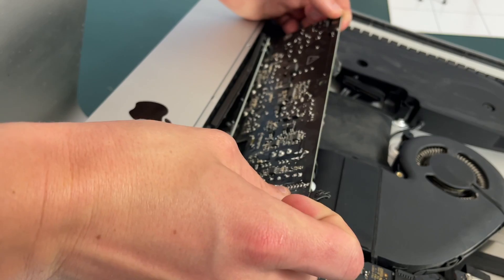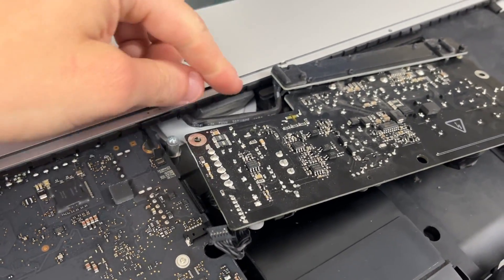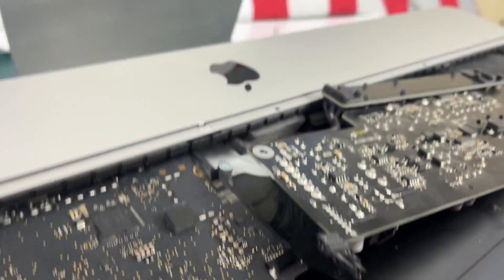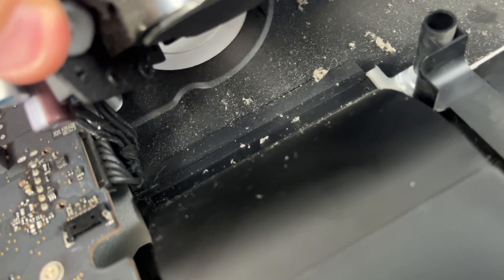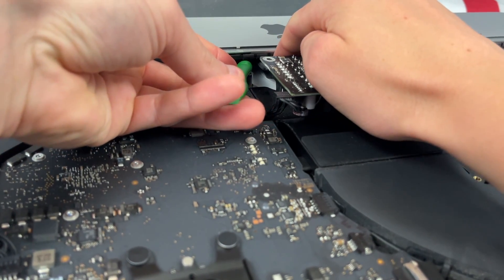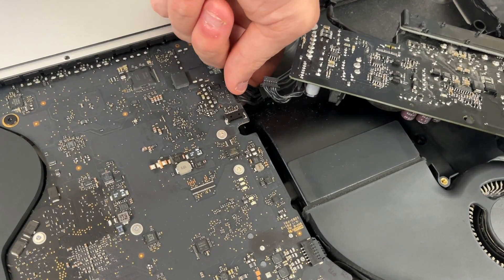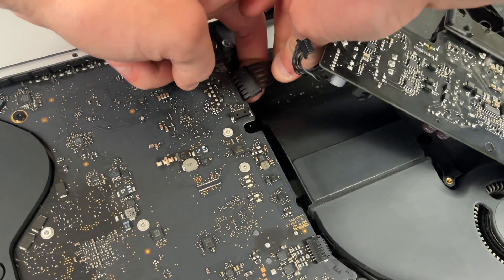We're just trying to gently disconnect it from the bottom of the iMac. We actually have two cables: one that plugs in right under the iMac, and another cable which attaches from the bottom and plugs in right there on the motherboard. To get the first cable out we're going to need to push on the release clip — you push on it and pull the cable at the same time. The big power connector is the same way: squeeze the clip on the back and pull out the connector at the same time.